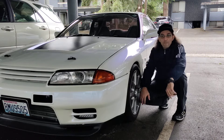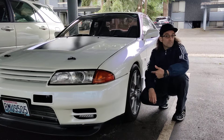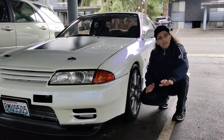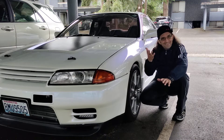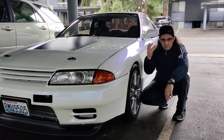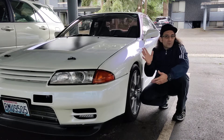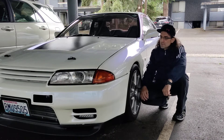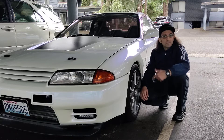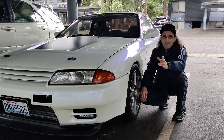How does the car go? The ECU is the stock one. I was ready to approach something else — maybe an inline piggyback upgrade from the stock ECU, or a Link ECU. But I don't need it. I started asking myself what was wrong when I watched other builds max out the AFR sensor and injector duty cycle around 12 or 13 PSI. Here the AFR is good, the MAF is not maxed out, injector duty cycle based on the laptop readout looks good. Signals are good. I'm running 15 PSI and nothing is maxed out.